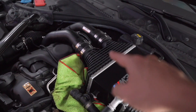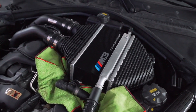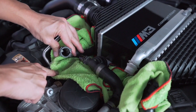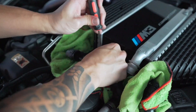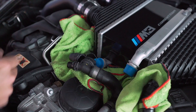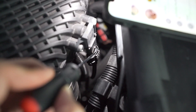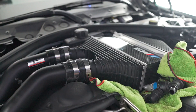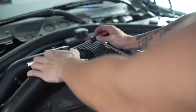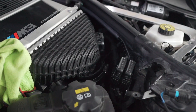Now that most of the coolant is drained from the charge cooler, we can start disconnecting the charge pipes from the hot side and then the cold side — the J pipe — just to get it loose so we can lift the charge cooler up from the grommets. Take your pick tool and disconnect this piping that goes to the outlet — no coolant is dripping. Do the same for the big one — no coolant dripping, bada bing bada boom. Next take a little 8mm and loosen up the charge pipe clamp. There's also a little sensor on the back — take a little pick tool, pry that back, and snap it down.